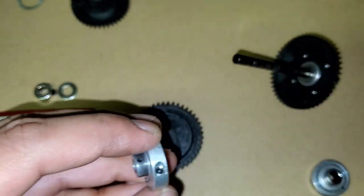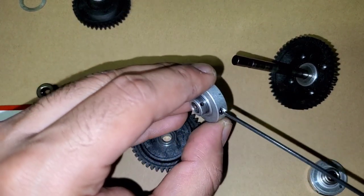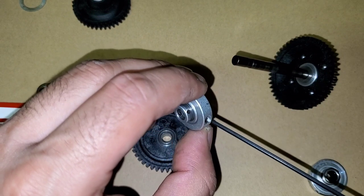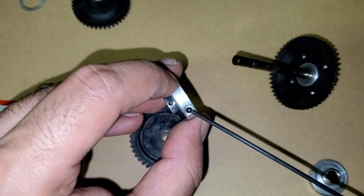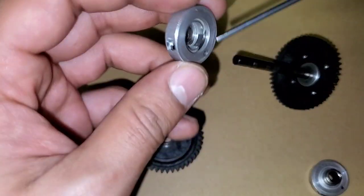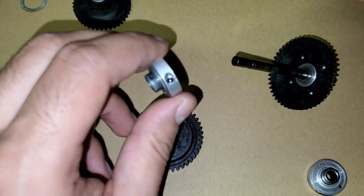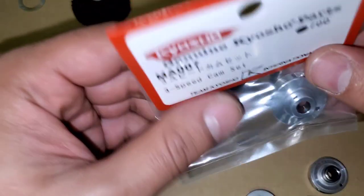I'm looking for the settings for this. Someone told me about the two-and-a-half setting, so I'm going to try that. Right now this grub screw has been bottomed out all the way — you don't want to tighten it too much, be careful because there's a spring in there. Tighten it down until it snugs up, then count back counterclockwise two-and-a-half turns. That's where I've got this one set. The first gear one I've got set a little looser so it engages earlier. Anyway, let's remove this pin and put it back together.